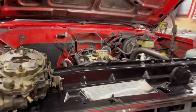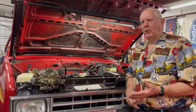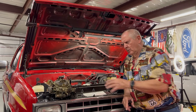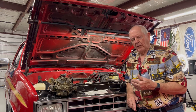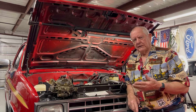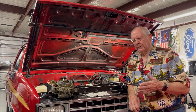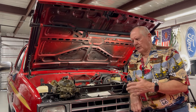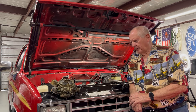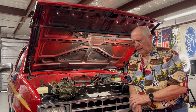So here's the summation of what happened: the timing was not correct — we reset it. The carburetor was not sending enough fuel anymore; it had gotten old and dirty and wasn't working right — we replaced it. We fixed the shift points on the transmission, and the pinging went away. This gentleman is going to be extremely happy because he's had trouble finding anybody that can fix this, and it takes experience to remember how all this stuff works.